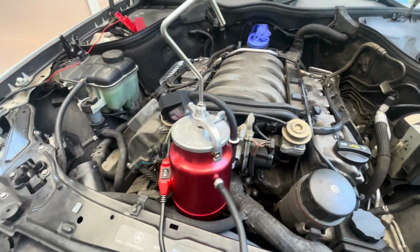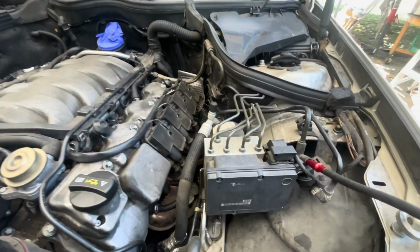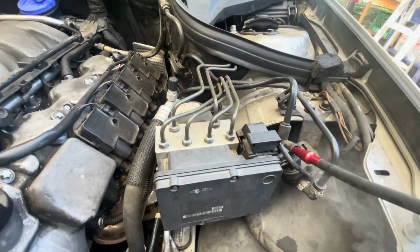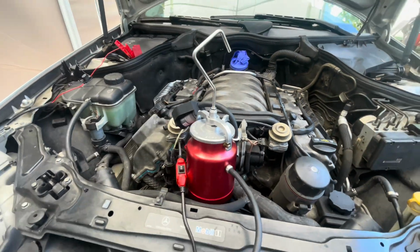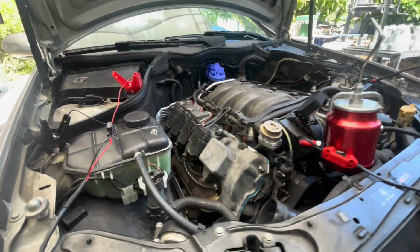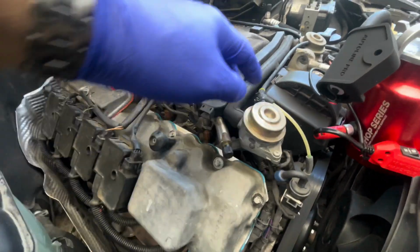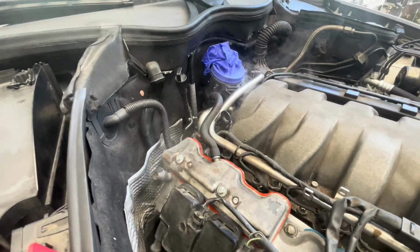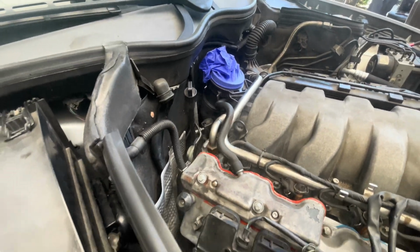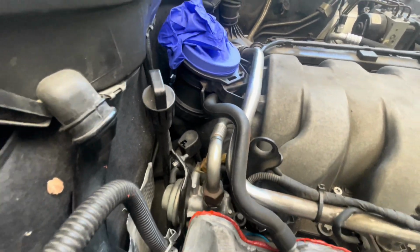So now I'm warming up the machine. I'm going to turn it on and we'll look at it together. Here I have smoke going. It's leaking a little bit from here, but it doesn't matter. This machine produces a lot of smoke, so we should be able to see it if there is a leak anywhere. Typically you'll see a leak around these vacuum lines possibly, but in this case you can see it's coming from the back. Let me get a light to be able to see it a little bit better.